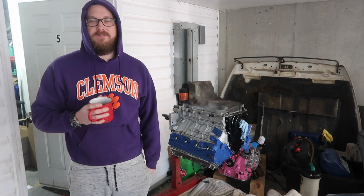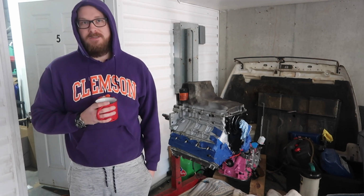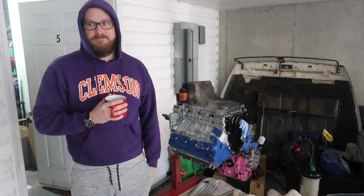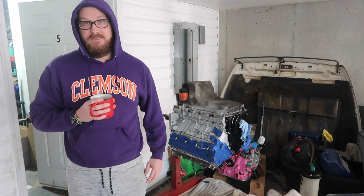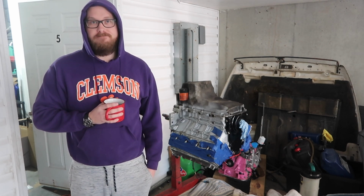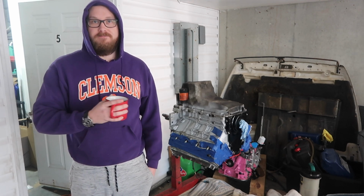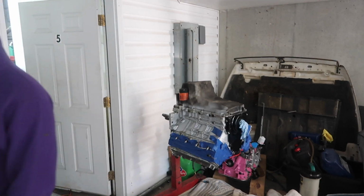We got a whole box of stuff upstairs. We're gonna get it done. It's gonna be a super basic build. 6-liter, Z06 heads, custom cam, low-rise, mid-rise intake manifold from China, most likely a Holley Terminator, and make 450 wheel, cost less than $4,000. It'll beat any rotary I've ever built. Check it.